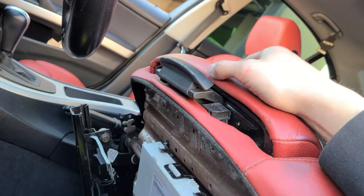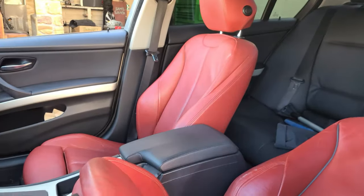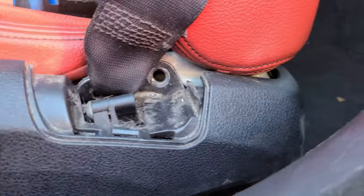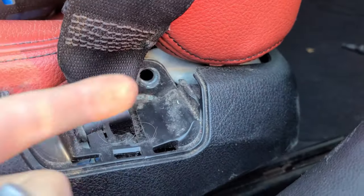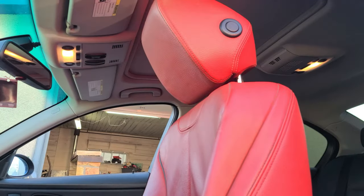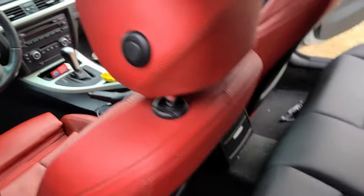F30 wires - didn't swap anything on the seat itself, just the plug and did some repinning. Both seats are in now. I still need to do the passenger side, repin it, and then do some wiring diagram research and clean up these seats. I have a red interior - at least red front seats. That's a start. That was the driver's side plug. As for the seat belts, the E90 is sitting in here nice and clean. Put on the rear two bolts and basically we're set. Coming along not too bad considering I have no idea what I'm doing.